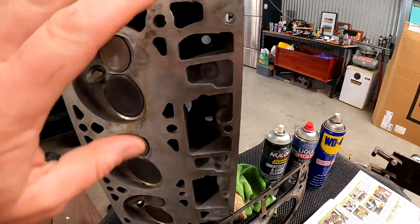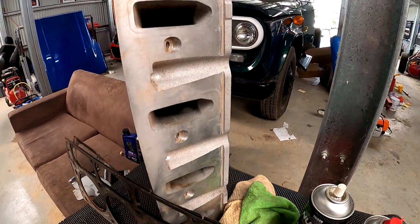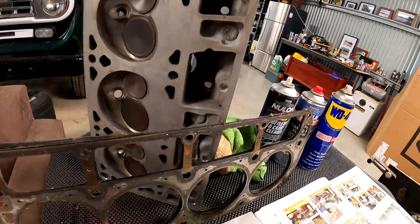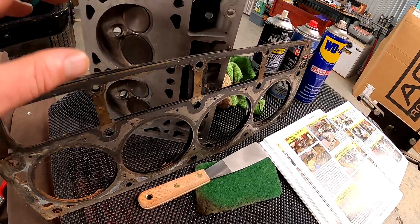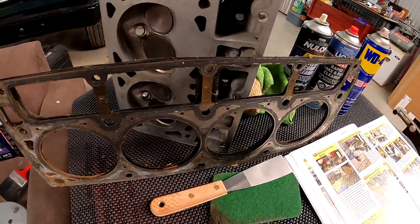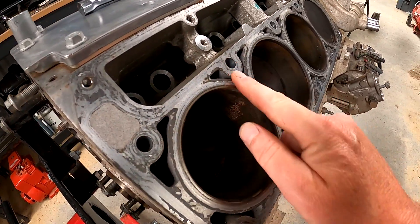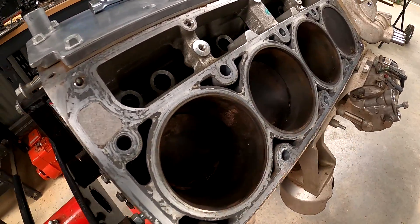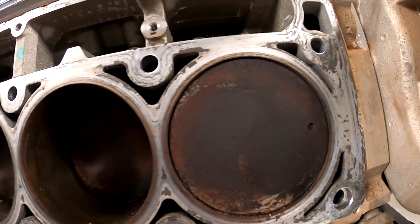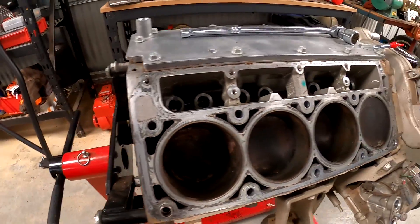When we're starting, obviously we get our cylinder head off. This is just for illustrative purposes — you can see the cathedral ported heads; that's actually an LS1, I'm just using it here as an example. The other one's already gone to Gentech. When you take the heads off, you get these nasty-looking gaskets that come with it, and they leave a huge amount of sticky juice and residue all behind — you've got to get all that off. And look at the carbon build-up in all the pistons as well.